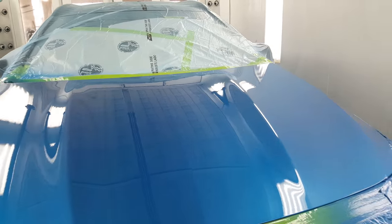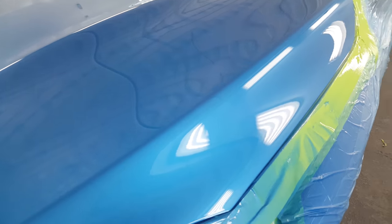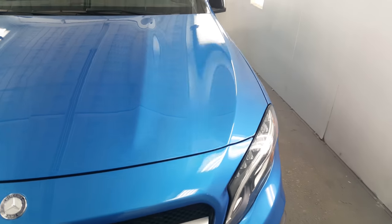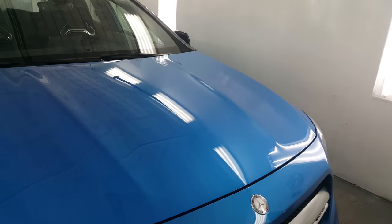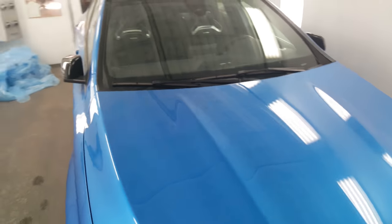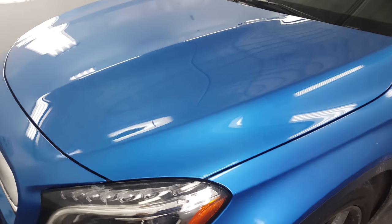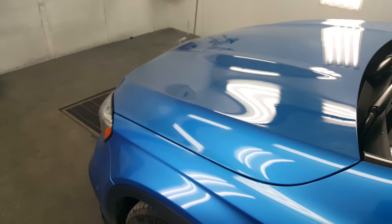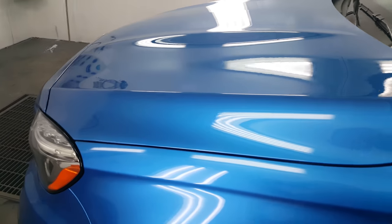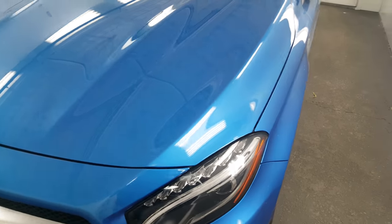Here's the finish — looks like we've got a nice gloss going on. Once we unmask that — boom, there it is. I'm pretty happy with the color match we've got here. There are a few ways this could have been handled if the color wasn't dialed in — you could bring it into the top of the bumper and the other fender, which would have multiplied the size of the job significantly. Sometimes you have to do that, or you could spend time tinting the color, but usually it's quicker and safer to blend in every direction should you need to.